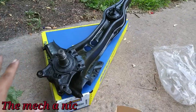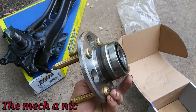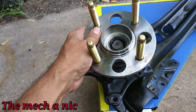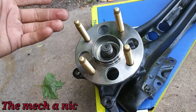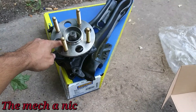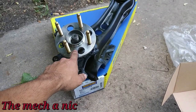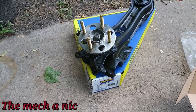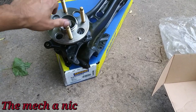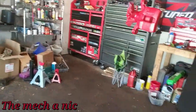I got the whole arm sprayed down and here are the new wheel bearings. I already installed the ARP extended studs. The wheel bearing just slid right on — that's how it should go. When I did the driver's side on the CRX this wheel bearing did not want to go on at all; I was hitting it with a dead blow hammer. I'm surprised and happy that this side went on nice and smooth. Of course I'm not going to forget — I'm putting the washer on right now, then the nut, and torquing it down.